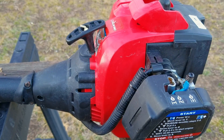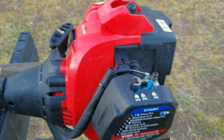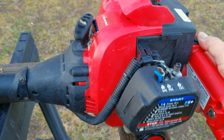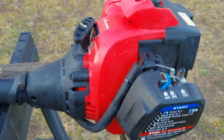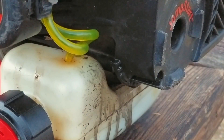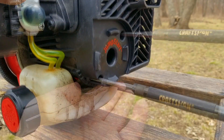I'm having some problems getting it to start so I'll use the jump starter, and I'll also move the choke to the run position. It's starting but it won't stay running, and it's usually at this point I would take out my carburetor adjusting tools to make a few adjustments. But that's when I noticed a large oily mess on top of the fuel tank that wasn't there when I first tried starting the engine. I'll admit the same type of oil residue was there before I filmed this repair — I thought it was just oily dirt stains from the fuel tank and cleaned it up, but I think it's actually a bigger problem than I thought.